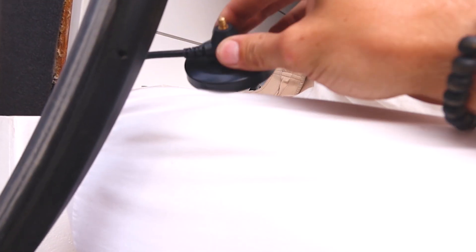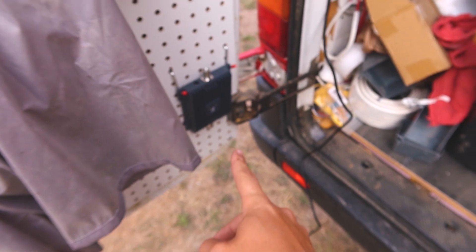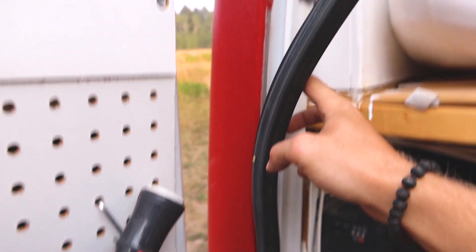To begin with, I'm going to try putting the inside antenna in the corner of this little cabinet we have. You want it to be at least 18 inches away from the booster, so that should be good. I'm going to have to zip tie all this extra cable up, and then run the outside coax cable that goes to the antenna we just mounted behind this weather seal.